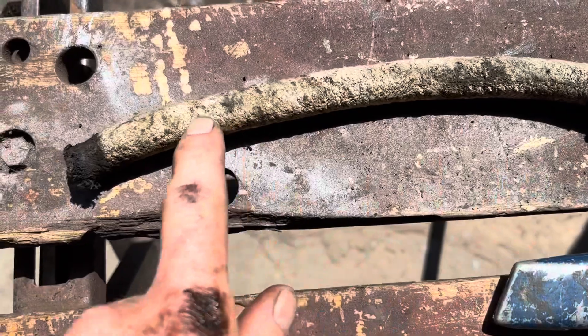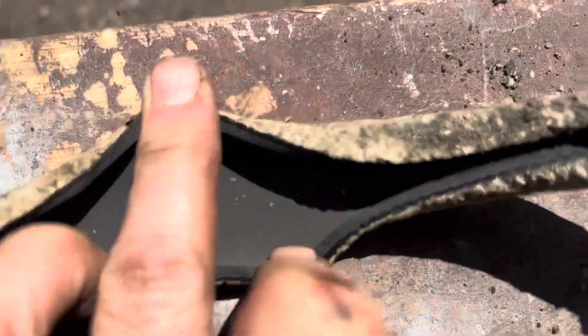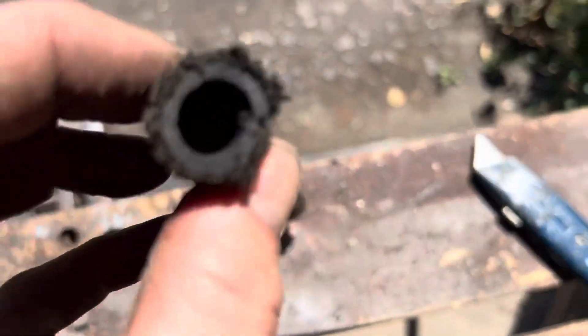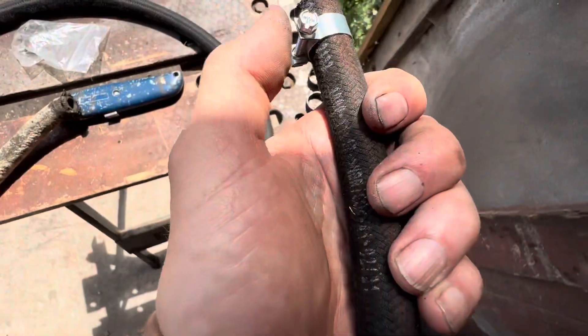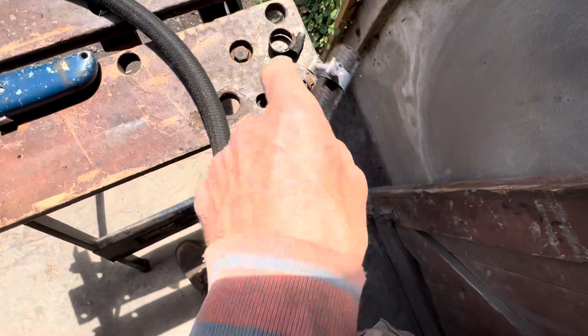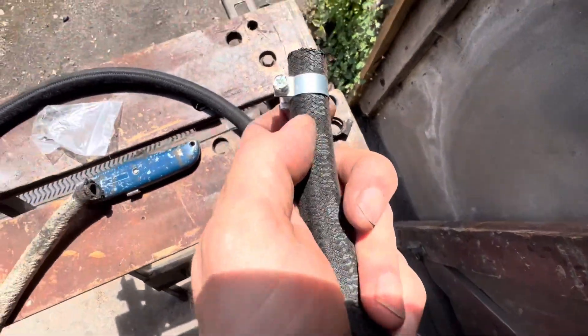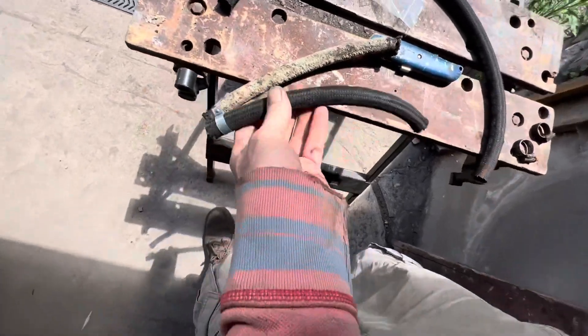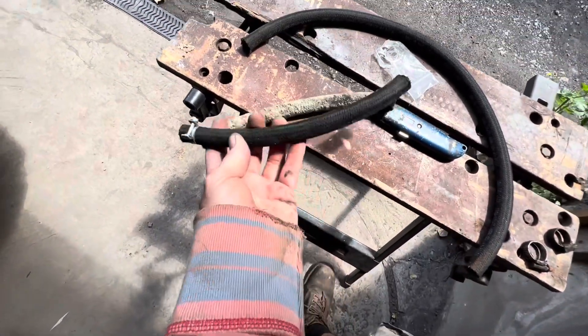In the interest of science I'm going to cut this hose open and see what it looks like inside. There are no signs of problems yet, which just goes to show it's what's on the inside that counts — but that is a pretty manky-looking hose. I'll also be replacing the hose clips with proper fuel hose clamps that clamp all the way around.